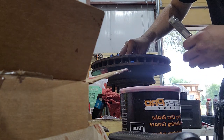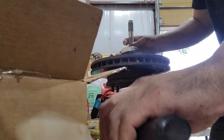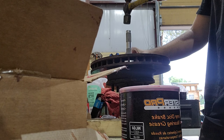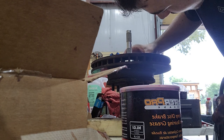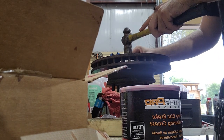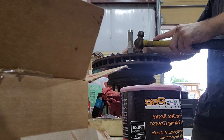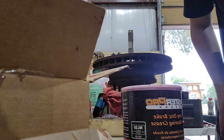All right, make sure this is as straight as you can. If you're not careful, this oil seal in here will slip, go crooked, and then while you're hitting it down, you'll actually be damaging it. So very lightly tap it at first. Make sure it's seating all the way. I can tell this one's not, so I'm going to try my best to fix it. All right, now it's seated, so with my hands not so greasy, let me wipe off this corner here. That is done. Perfect.